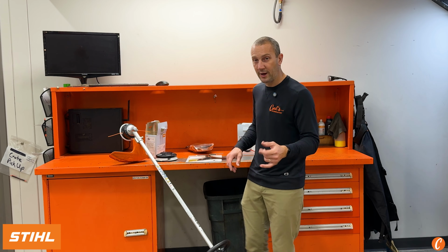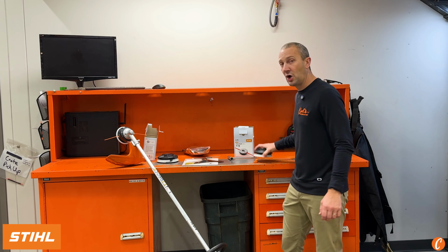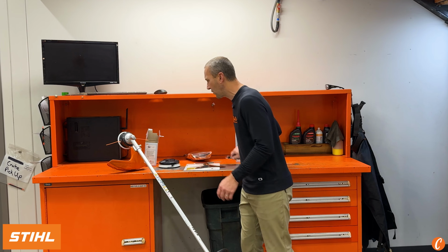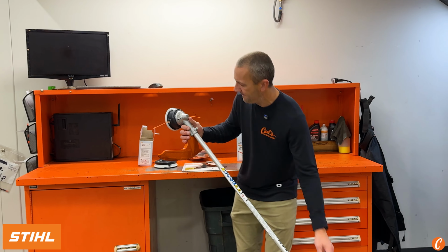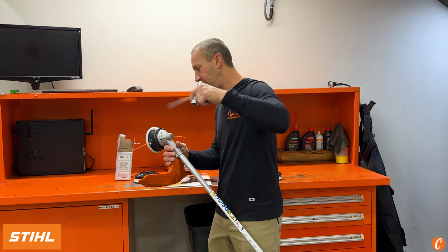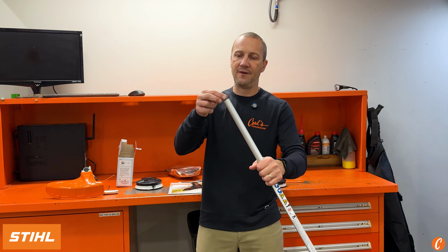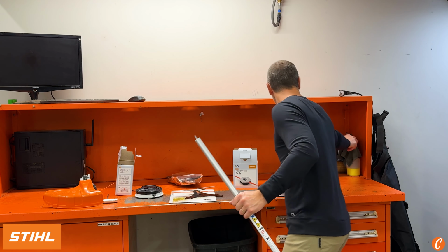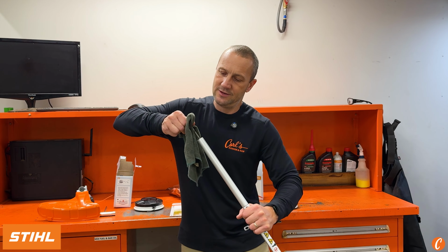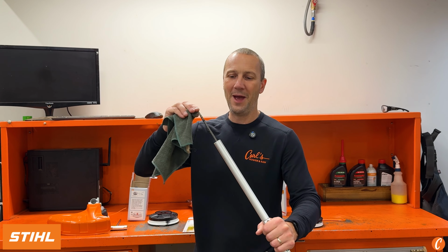Before we go into a blade, right? This DuroCut head, I can put this on a cable drive. This PolyCut head, I can put it on a cable drive. What do you mean by cable drive? Let's take a quick peek. I'm gonna slide this gearbox off. Take one bolt loose. Gearbox is off. And here is a drive shaft, a solid drive shaft, metal from head to toe.